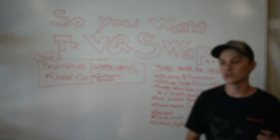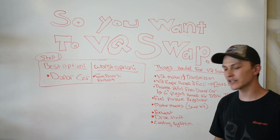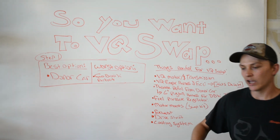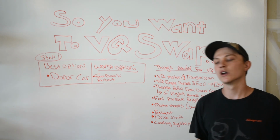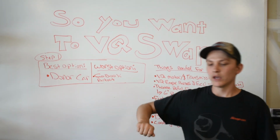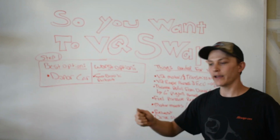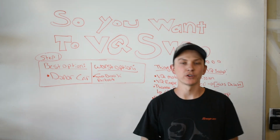NATS delete. NATS is Nissan's security system. It's kind of like the Honda immobilizer, and essentially it's a CAN bus system that talks to the body control module and says, "Hi, yes, the key is in, and I'm a Nissan 350Z." And the engine goes, "Hi, yes, I'm an engine for a 350Z, and we're ready to start," and the engine starts. When you put the key in the ignition on your freshly swapped VQ swap, and you haven't done a NATS delete, your ECU is going to go, "Hi, I'm a Nissan engine, where's my body harness?" No body harness, no signal, it's not going to start.